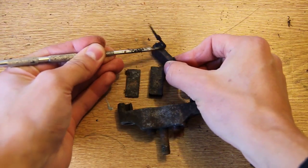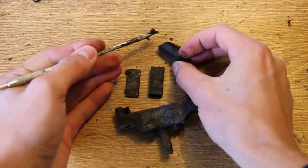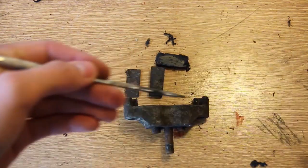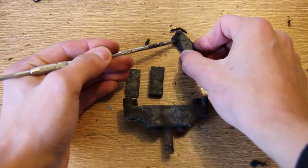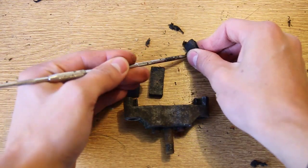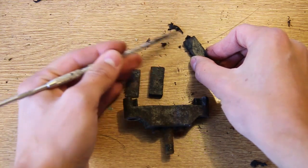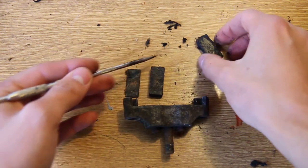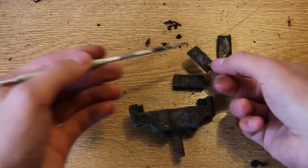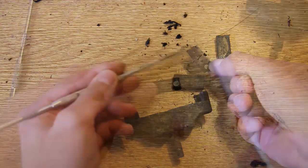The brake pads need to be cleaned and inspected for any cracks. If the brake pads are damaged in any way, or if they've got fractures and hairline cracks on them, you will need to replace them. If they're too worn they'll have to be replaced as well. They're not too expensive and you can still get these parts. I'm just cleaning off the majority of that grease and dirt, along with the metal plate which the two studs push against.